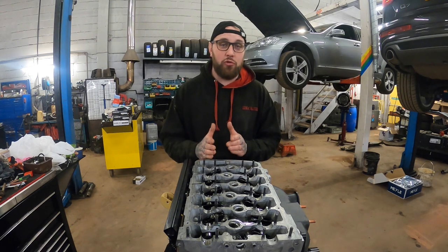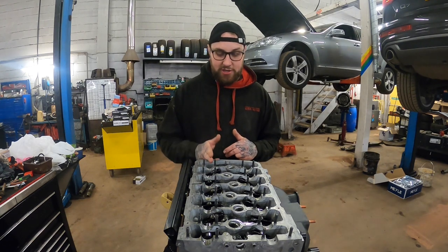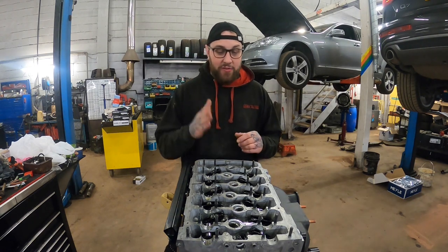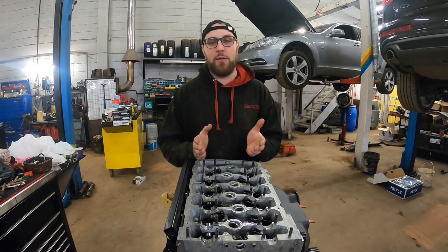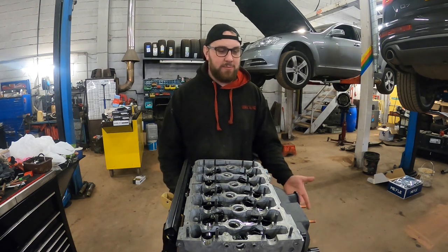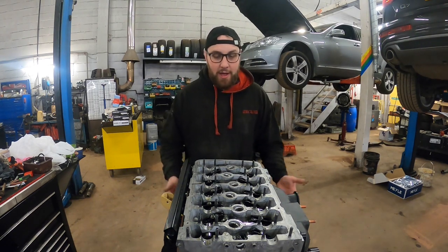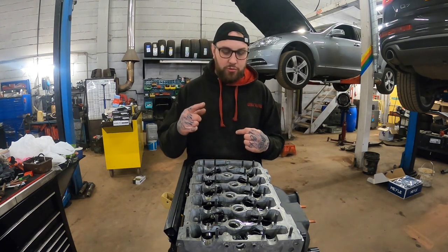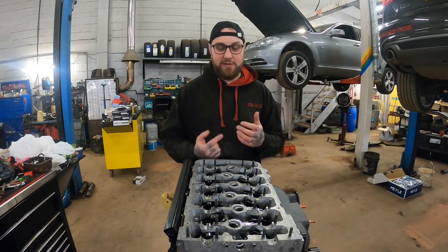I'm so glad I went down that route, because he got them out and said basically you've got six short valves and six long valves on the intake and the same on the exhaust. He said my long valves on both intake and exhaust - all 12 long valves - are bent, or more accurately distorted. When he said bent I was like, how can it be bent? The timing chain data was all right and it drove fine.